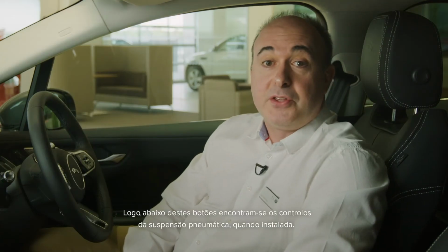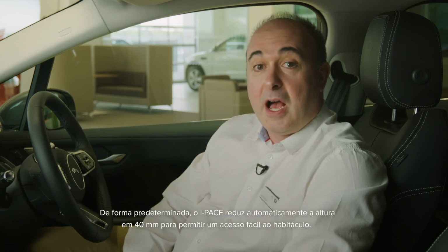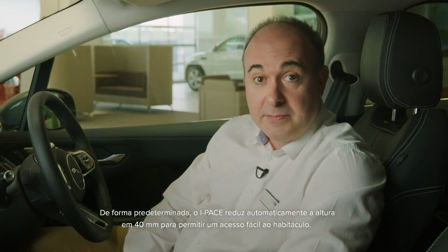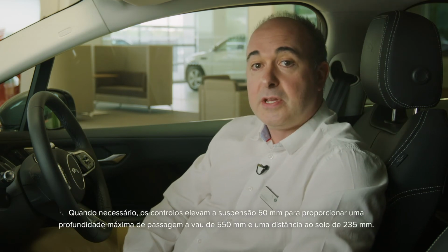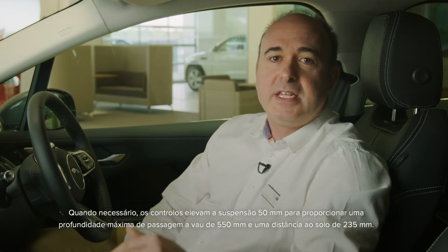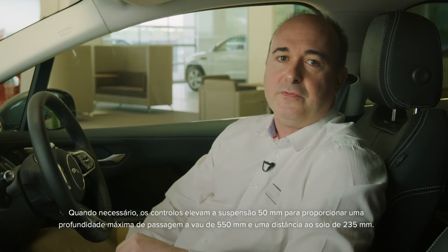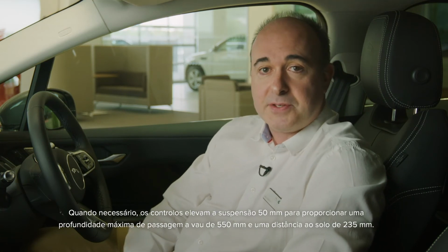Just below these buttons are the controls for air suspension, if this is fitted. As standard, I-Pace will automatically lower 40mm to allow easy access in and out of the vehicle. When needed, the controls raise the suspension 50mm above normal drive height to give a maximum wading depth of 550mm and ground clearance of 235mm.